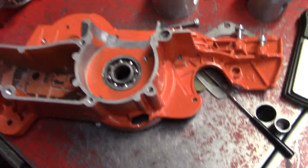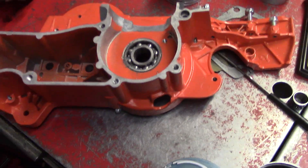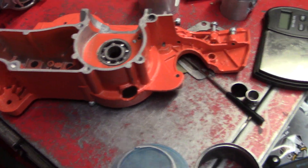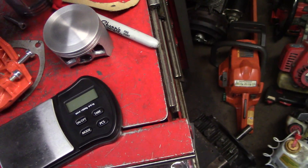These are the Farmer Tech bearings - they're coming out of there. I got SKF bearings, I got highway seals, I got an NWP crank. So that's going to be a pretty good saw, this one - the 86-er. I'm not in a real hurry to get it together, I mean I'd like to see it run.